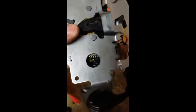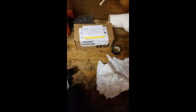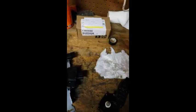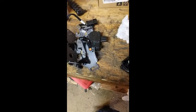Looking at the old latch assembly, you can see the gear the motor turns - it looks fine, no damaged teeth. There's a small micro switch that a cam presses when the gear turns - I can hear it clicking on and off. I do have a new motor, so there's a chance it could just be the motor that needs replacing. Here's the old motor - the teeth on the drive look fine. I don't see anything obviously wrong, but being Sunday I might as well try putting the new motor on the old latch assembly and give it a shot.